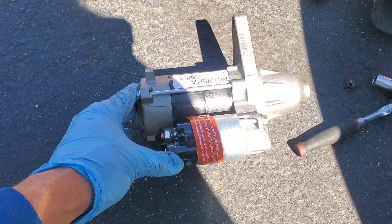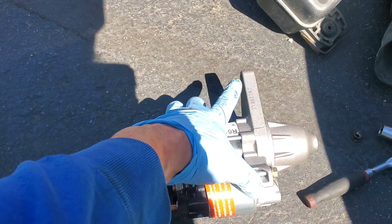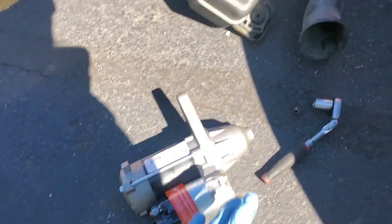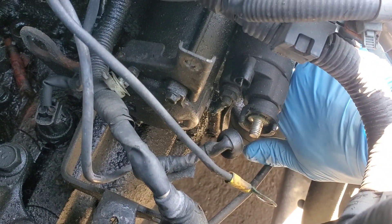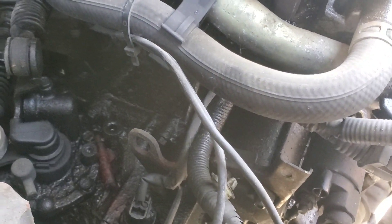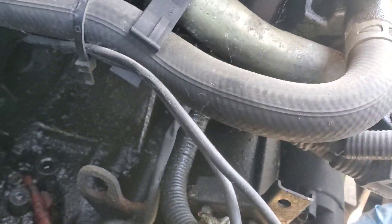After taking a look at the new starter, the starter pretty much sits in there just like this with the solenoid facing the front of the vehicle. So we have one bolt right up here, and then we have the other bolt right underneath the solenoid. You can kind of see that top bolt right there, and the bottom bolt is going to be right in this area — you can kind of see where my finger is moving. With all this space in here, you should be able to get to that relatively easily. They should be 14 millimeter; if not, they're going to be 17 millimeter. I'm going to test out, see what size they are, and get those bolts out.